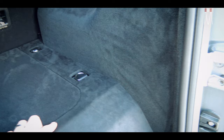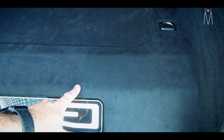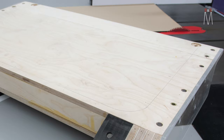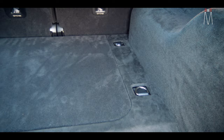This whole panel is one organic piece of PVC. I basically routed it out in 2D, all flat, then notched it on the table saw and used heat to completely bend it all into one shape. We have a ton of magnets back-loaded on this panel that snap it right into place — about 13-pound magnets — so it's not going anywhere and they're not rattling or chattering.